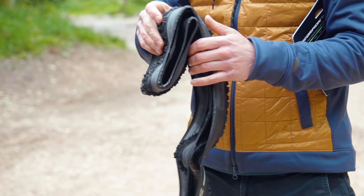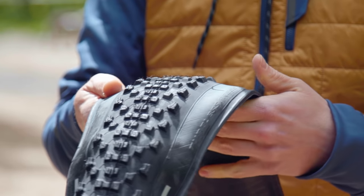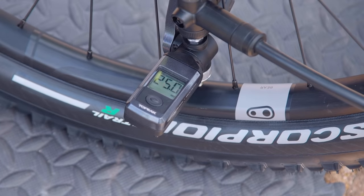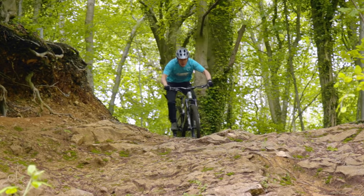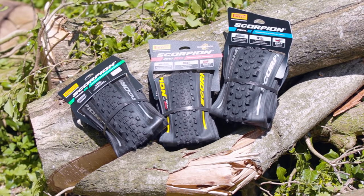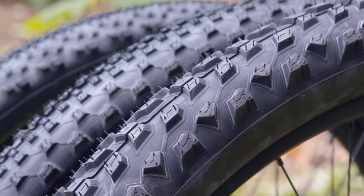The next key variable with a tyre is its carcass — how the tyre is constructed. Often manufacturers will supply the same tyre tread and width with a number of carcasses, as different carcasses have pros and cons. A thicker carcass will have more puncture protection and may have a more damped feel, but it'll be heavier and as there's more material in the sidewall, it could be less supple, changing how efficiently it rolls. As a thicker carcass tyre is inherently stronger, in a mountain bike application we might be tempted to run a little less pressure. A thinner tyre might be run at a touch higher pressures to guard against punctures, and with that suppleness it should still deliver grip and comfort. We might also quickly consider tyre compound: a soft compound tyre will give more grip for a given pressure, so you might consider adding a touch of pressure for more puncture protection and stability while retaining grip.